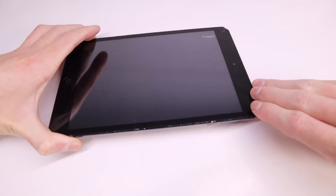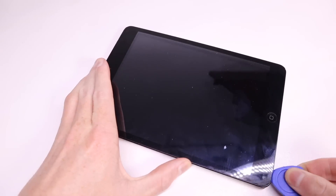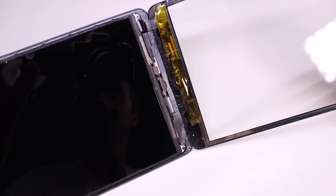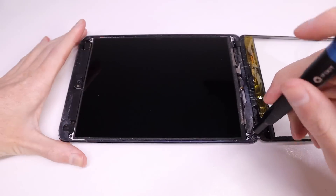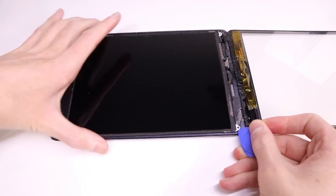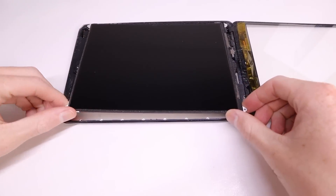To get into the iPad and begin repairing it I'll need to remove the screen. Usually heat needs to be applied to loosen the adhesive and pull the screen away from the frame. However, the screen on here is such a low quality installation job that I could literally pull it up with my fingernails. With the screen removed I can remove the four screws holding in the LCD panel. One thing I really like about these older iPad minis is the fact that the screen and digitizer are separate, making repairs easier and cheaper to do.